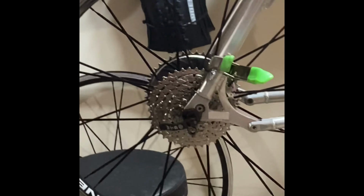so take a step back. You got a chance to see we're a little bit further along on our gas bike. Last week we gave you a video on aligning the sprocket here. So we got that sprocket all aligned. I went back and checked it with a dial indicator, and it was about 20 thousandths of an inch within tolerance as far as alignment. So it's within about 20 thousandths of an inch concentricity and side to side alignment. So it's starting to look like a bike.